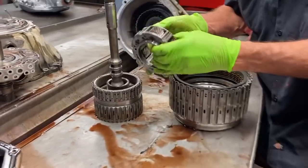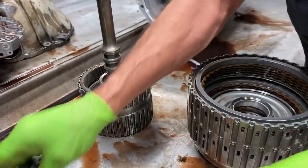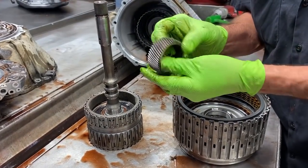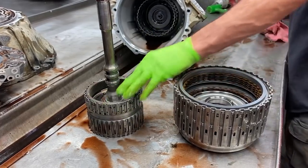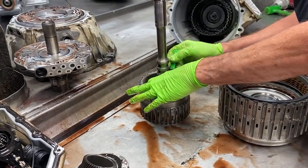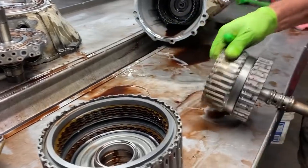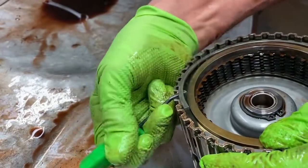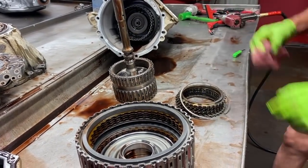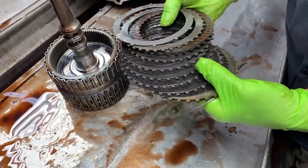Of course we're going to get in here and pull our planets out and stuff — got a six-pinion setup. This is a 6L90 — a lot bigger tranny. Just look at all your planets and stuff, make sure the pins don't wobble, anything like that, and they haven't changed any colors, so we really don't see planetary failure on these. Get your sun gear on both sides — we have a six-tab washer down here, Teflon rings, and also a bearing down in here. We're going to go ahead and look at our 3-5 clutch here.